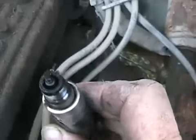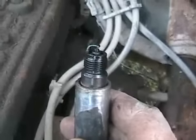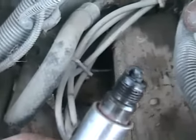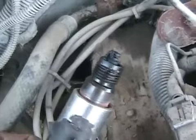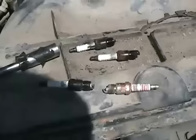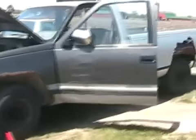Well there's a good reason they're bad — all black and gooey, that'll never fire. The back cylinder on both sides is the one that's not running. Holy god, that one is ever bad — there's chunks of carbon even bridging the gap. No wonder those didn't work. I managed to find two good spark plugs in that sea of junk. They're in now, we can try it out. Let's fire it up.